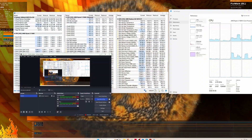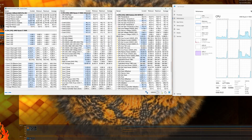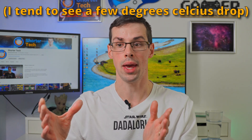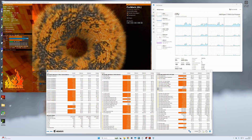As a result, putting case fans right above the PSU to ideally cool your GPU could actually be considered a bad thing. But really, this just comes down to testing. It's quite easy to have the fans there, run FurMark and check the temperature, then disconnect those fans — preferably when the computer is off — and rerun FurMark and compare the temperature results. Then you can see for yourself whether or not those fans under the GPU actually benefit you or not. So you can just do your own testing.